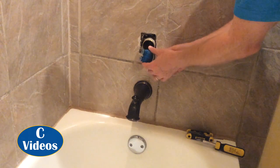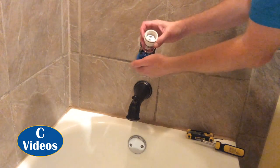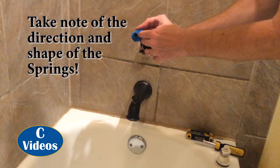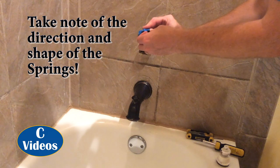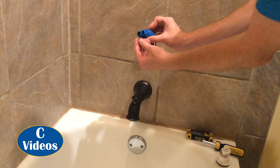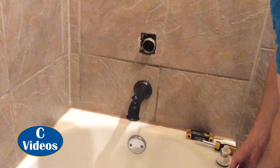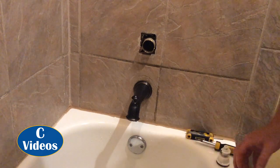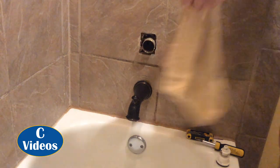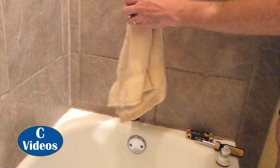Next we just pull this out firmly — wiggle it back and forth and pull it out. I might have some obvious calcium deposits up in here, so get those out and clean them out. Then you take this, just a little bit of a turn, and everything is going to change out today. When you take these out, pay attention to which way they go — the springs are not symmetrical. They have a cone shape to them, and the bigger side of the cone goes in first into the unit. While you've got it out, make sure it's nice and clean up in there with no calcium deposits. If there are, take a paper towel and just clean it up.